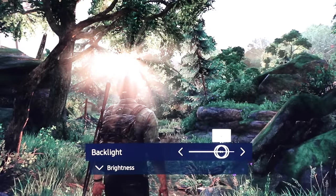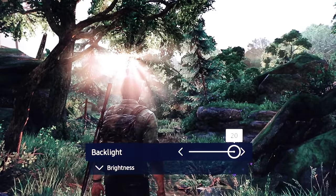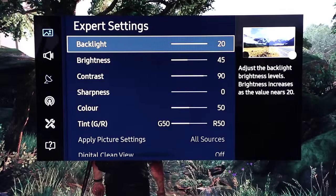So in theory this sounds incredibly complicated. Should Samsung be doing all of this automatically in the firmware? Yes — and in Movie mode it mostly does; the key options are selected except UHD Color, which you have to manually do regardless of what mode you choose. In terms of backlight and color space, those are set to auto and ramp up automatically. Game Mode does work with HDR now, but it doesn't actually sort out all of the settings for you — you have to do that manually.